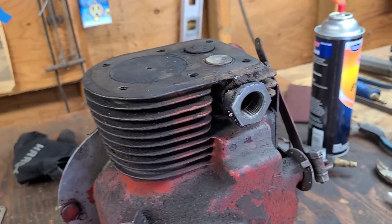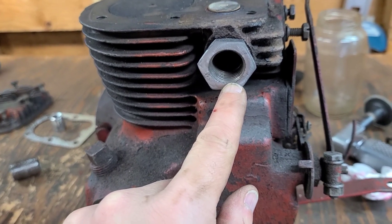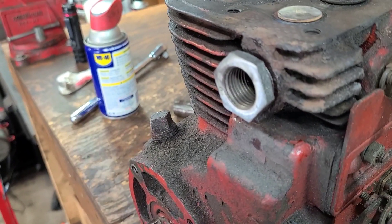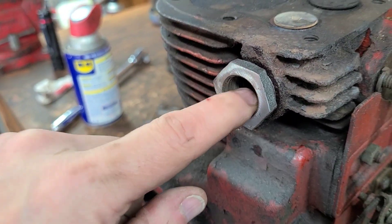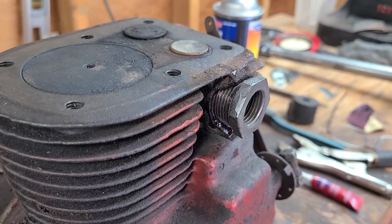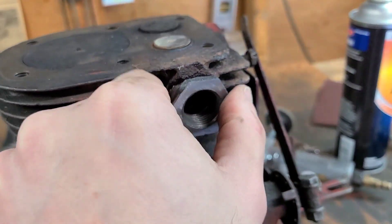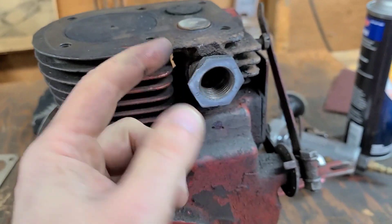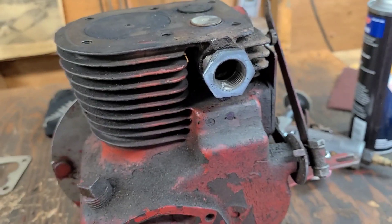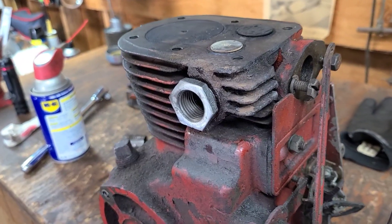There it is. I was thinking about cutting this off, but then I stopped myself because this is a tapered thread. I really don't want to cut that much of the bushing off because the threads are going to be tighter on the inside than on the outside since it is a pipe thread — that would be bad. So I stopped myself before I ruined it. The red Loctite is setting up and I tried to adjust it so the point was in the up position, but man, that thing is tight already. That stuff is setting up good and that's going to make this 100%.